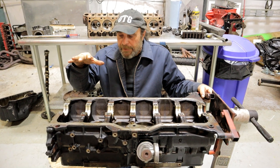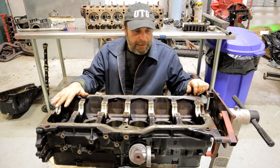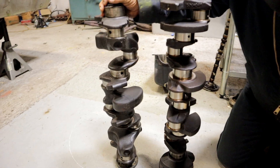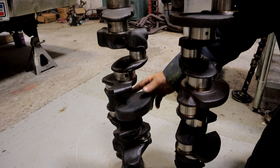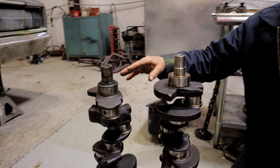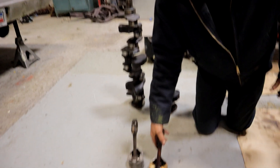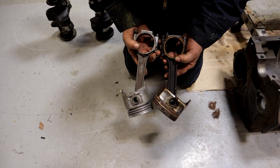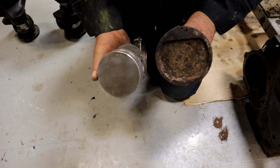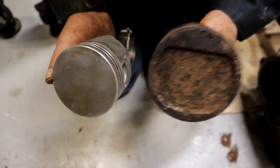Let's compare the 225 Slant 6 to the Jeep motor. Aside from the obvious difference in the number of main bearings and the overall length of the block, here are the cranks — you can see they're similar but different. The 225 has this massive counterweight where you'd find a main bearing on the Jeep. You can see just the general length difference and the height difference between these two — it's about two inches, same as the length difference in the block. The Jeep connecting rod is a little bit beefier than the Slant rod, a little bit thicker in the beam section. And here's the big difference: the 3.4-inch Slant 6 bore versus the Jeep, showing a significant difference in bore size and therefore power-producing potential.